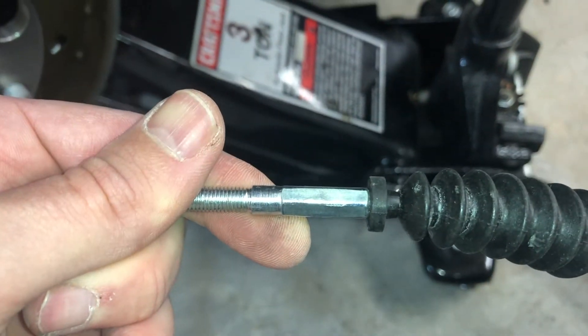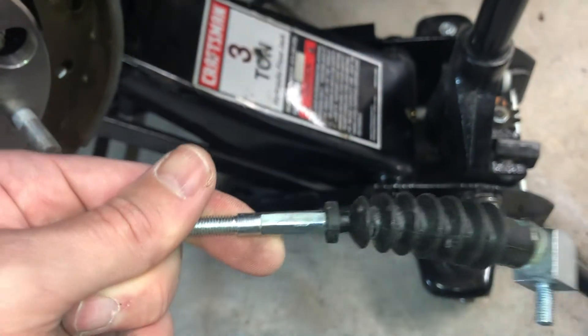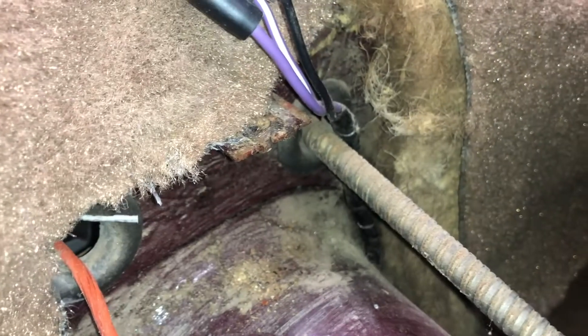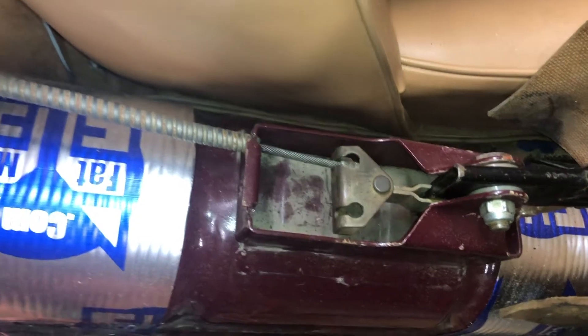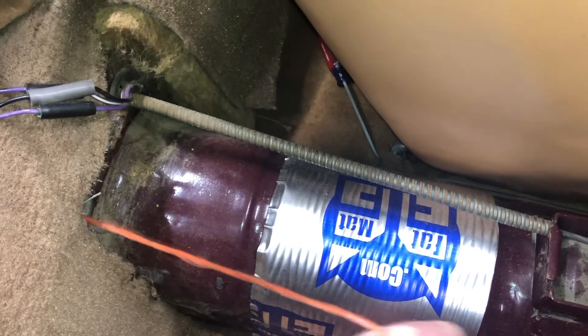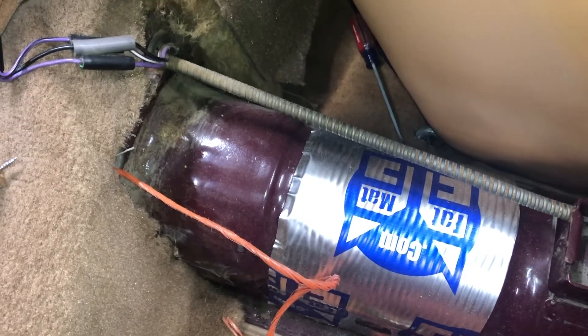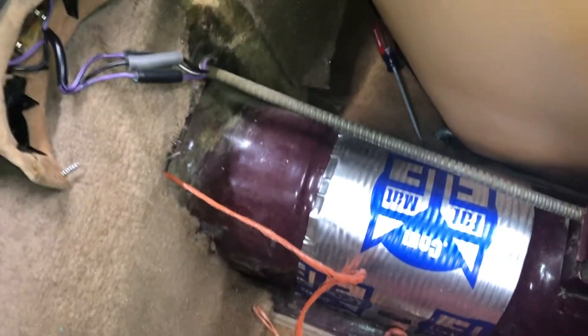Here are the new cables from Moss — they have a squared end so you can put a wrench on them if you need to adjust them again. What I did was pull off the old cable and tie a piece of string to it so I can feed the new one back through the grommets on the inside. There's where it comes through the back of the bulkhead — there's the driver's side cable — and then it attaches right in here to the handbrake. In theory I should be able to pull the string back through and pull the new cable in, though it's a tight fit up there.